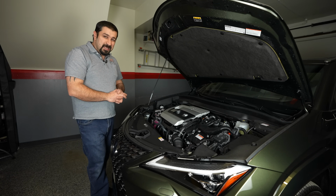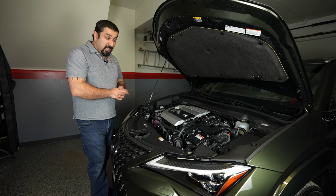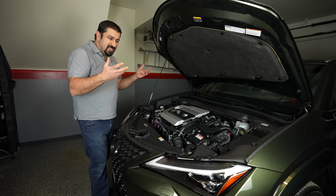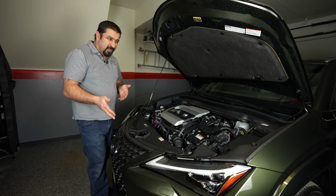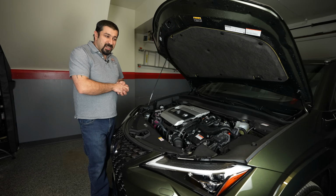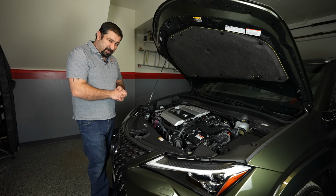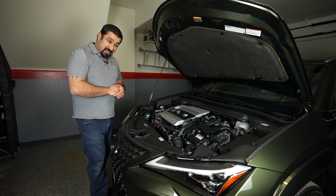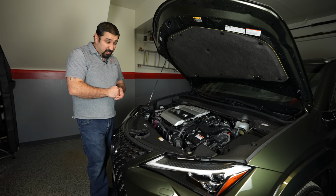But that's the P711. There is not a lot of data on this transmission reliability-wise. However, because it is basically the same design as the one going all the way back to 2001, theory-wise, and because we're talking about Toyota Lexus, I don't anticipate a lot of problems with it, especially with that cooler. That's even less heat. Heat creates problems in transmissions, so life is good there.